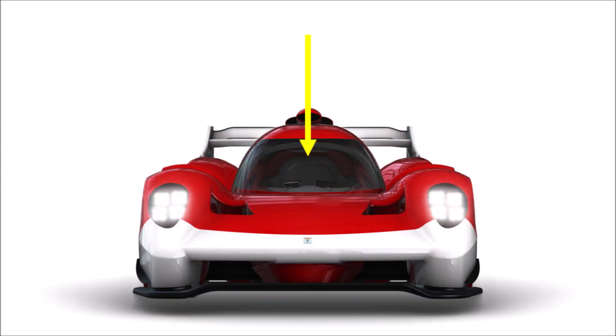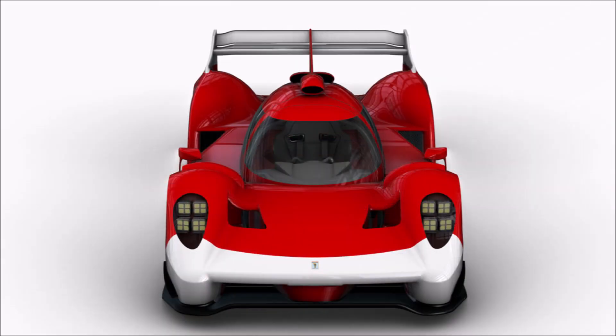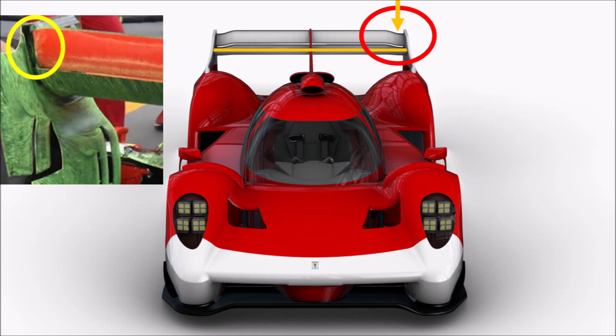Interesting is the center seating position. The rear wing has a lowered outboard flap trailing edge but the main plane leading edge is the same across the span. This means they run a reduced camber outboard which creates less pressure difference close to the end plate, which means a weaker tip vortex and less induced drag. Also the shorter outboard chord means less interference between the boundary layer of the wing suction side and the end plate, which creates a flow separation and decreases the effective wing surface. In other words, this feature makes the rear wing more efficient.